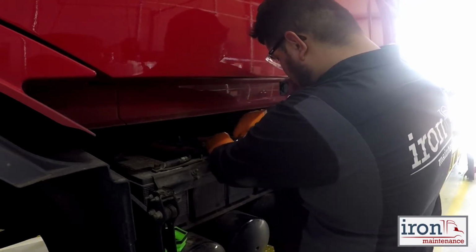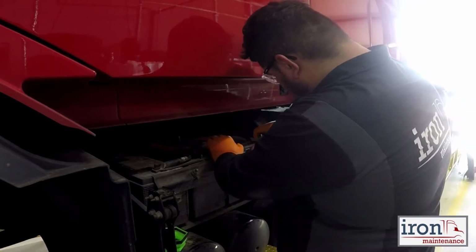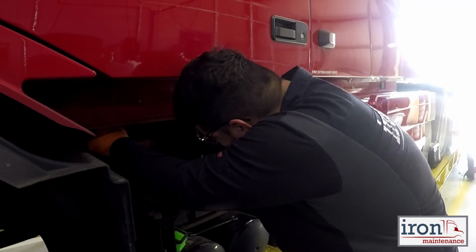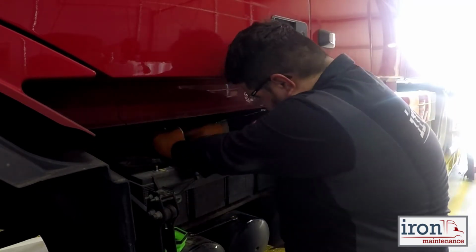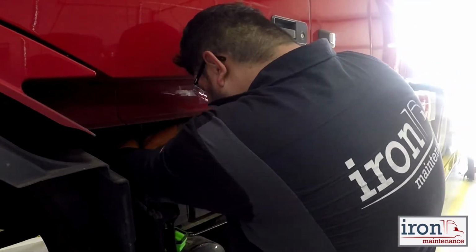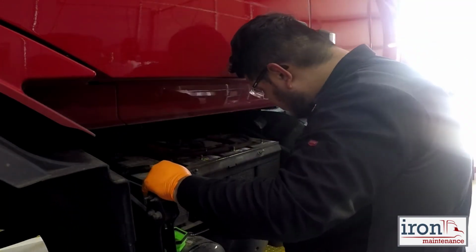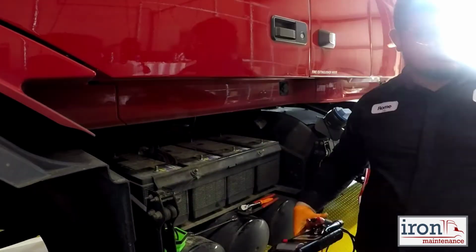Always make sure you are wearing safety glasses, gloves, and if possible using insulated tools to avoid electrical shorts, and always disconnect the negative side of the batteries completely before disconnecting the positive side. To properly test the battery packs, all the batteries must be tested separately with all cables and tie cables or straps removed. This makes sure there cannot be one bad battery in a pack that may not be detected during testing, or one of the pack of one big battery.